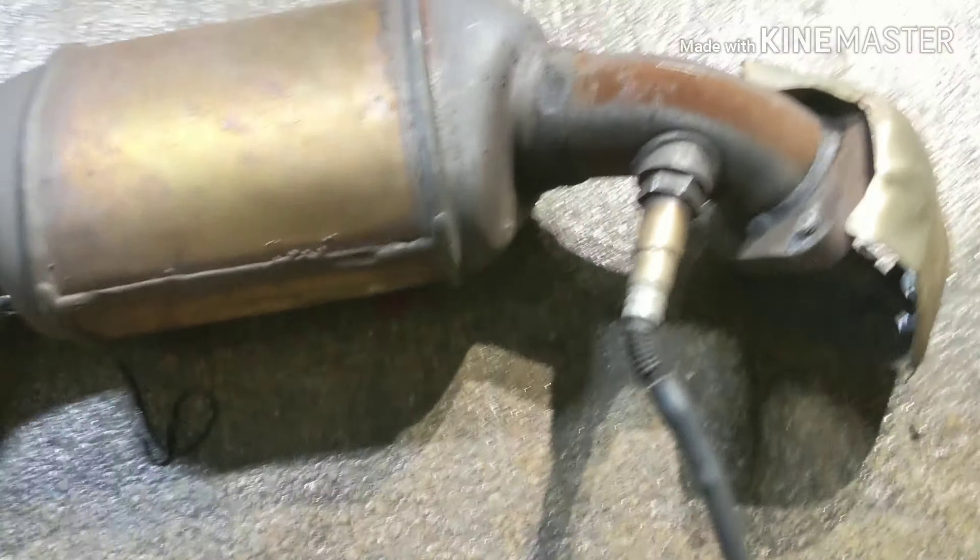I'm gonna show you exactly what I'm using. It's a half-inch flex extension ratchet — see how this one bends? You definitely need one of these with the bend because that's the way you get in there. And this is a 15mm socket — it has a lot of teeth but a regular 15 will work. Basically I just put it right on top and work it loose. That's how I got both of them loose from the bottom.